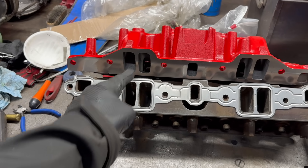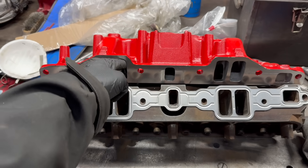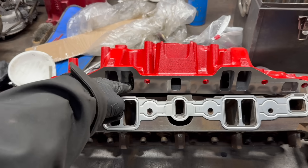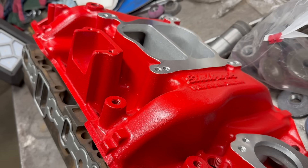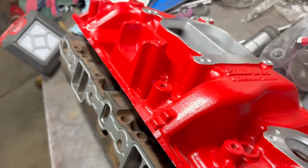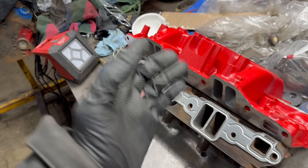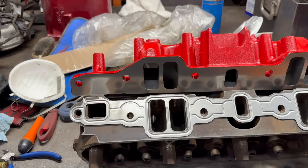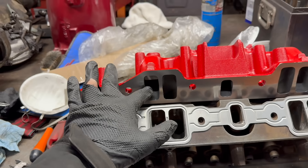The airflow can do crazy things when it's trying to ram into a brick wall. Now, if there's an overhang in the other direction — this port is smaller than this port, for example — you're not going to have the brick wall effect, but this is essentially a bottleneck. The best case situation is a perfect match between the two ports. The intake manifold of choice for this application is a simple street manifold — it's the Edelbrock Performer, labeled as the Performer 318-360. But the thing you have to know about the Performer is it uses the smaller intake port size of the 318 head. You can bolt it right on a 360, and I've done that many times with good results, but the intake port is smaller than the 360 head — not the best for flow.